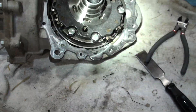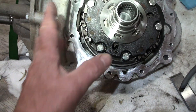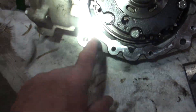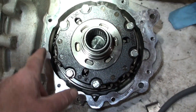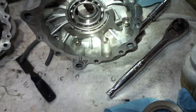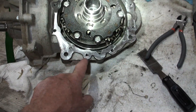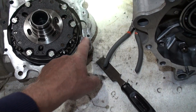That bearing doesn't just pop off — it takes a little effort, so if you actually had to do something like that. I looked at the wear marks on mine and it looks perfect. Right now you just go in here, put some sealer around this, put it back together, torque it back down, and that's about it. You just have to go in here and clean up all this old sealer around here, going around these holes.